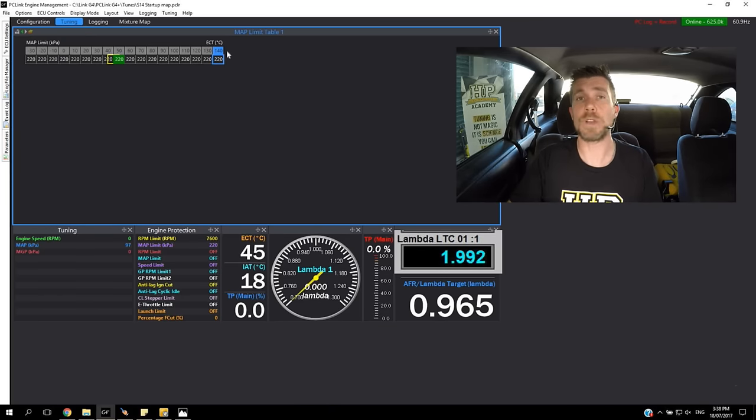So we've set a manifold pressure limit. If during our first runs we find that the manifold pressure is going crazy — maybe there's a problem mechanically with our wastegate or boost control system — this is going to protect the engine. We've got a safeguard in place straight away. At the same time we also want to begin by running on minimum boost pressure. So regardless of how our boost pressure is controlled — whether using the ECU, an electronic solenoid, or a manual pneumatic bleed valve — whatever we're doing, we want to make sure that for our first test runs on the dyno we are going to be seeing the minimum boost pressure that the engine can produce. We're starting with the minimal amount of load on the engine, the safest possible configuration, which is obviously at the lowest boost setting. Once we've got everything tuned and calibrated there, then we can start increasing the boost pressure.